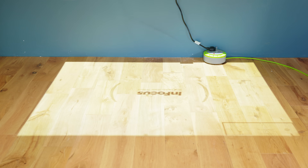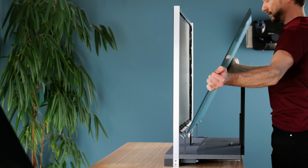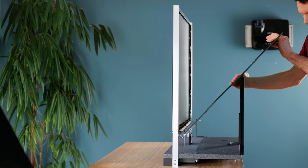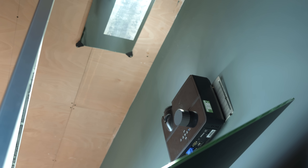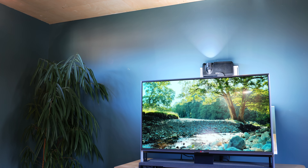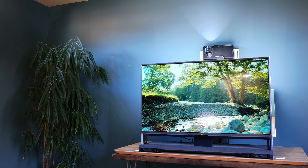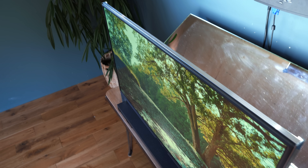This means that by adding some brackets to the TV's stand, we can add another mirror behind it at a 45-degree angle. When this is moved into position and lined up, it'll receive light from the projector despite being significantly closer to the wall. Admittedly it's not super elegant, so I'm going to keep my eyes open for a short-throw projector to upgrade to — but this is a good solution for using long-throw projectors, making the project more accessible than ever.